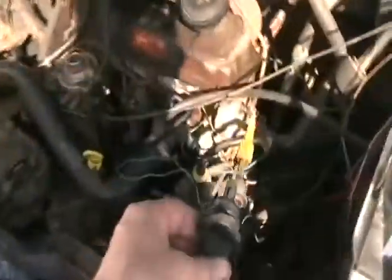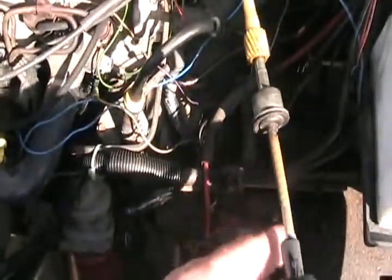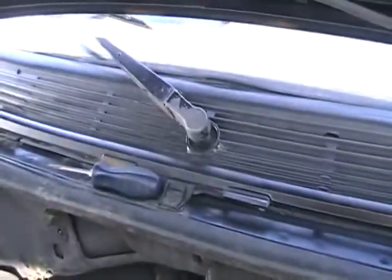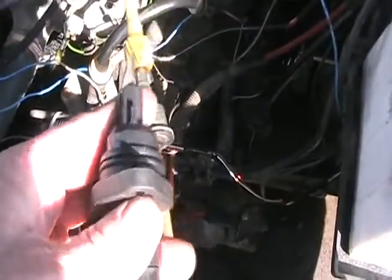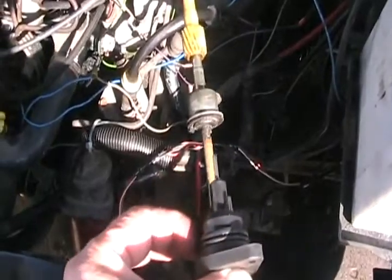Cool. Well, now I think I can easily connect that to that. It's got a small little end, the same size as the speedometer cable inside there. So if I just cut that off there, get rid of the outside cover, get a little piece of rubber hose, like the kind that might feed your wiper arms for the washer system, join the little piece of cable from there to the little piece of cable there by shoving a rubber hose on, then it makes like a universal joint coupler. Then just make a little metal bracket that will attach to that hole, and maybe MIG weld it or clamp it onto the hose clamp to that metal cylinder. Then this piece will be like that. That can go back in the transmission hole down there. And it should work. Let's do it.